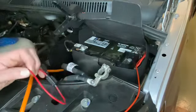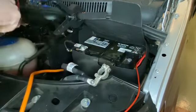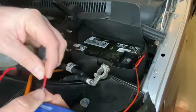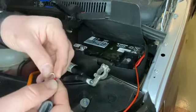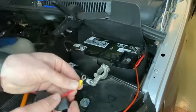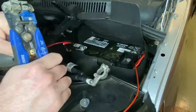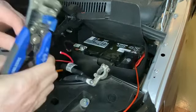Using a pair of snips, I'm going to cut it there. Then using these little wire strippers — you can find them on eBay anywhere — I'm going to strip back the insulation. I'll twist the wire, fold it over, and make sure it's a good firm fit in the ring terminal. We can see our ring is going to go over the battery post, so now we need to crimp this down. Get the cable in nicely and crimp it down really firm so it's got a good strong connection that's not going to pull off.